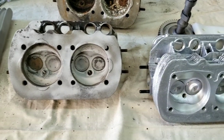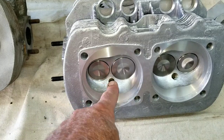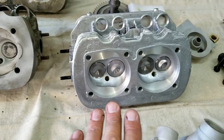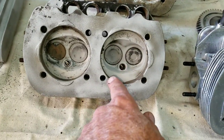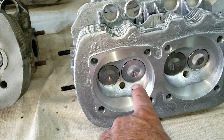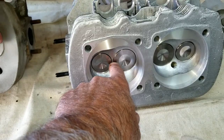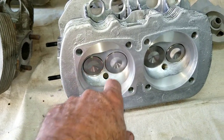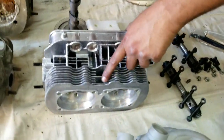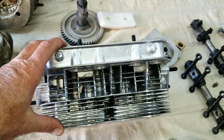But look at what they did with the AA heads. They go with the small peanut spark plug, and you can see how much more built up this is and how the combustion chamber has a better form to it. The form of this has better airflow. These have larger valves than the stock heads. A lot of the issues are cracks between the valves and cracks between the spark plug and the valve, especially when you go big valve. They also opened it up a little more for the fins — there's not as much cast in it. They actually made the fins so there's better airflow going through there.